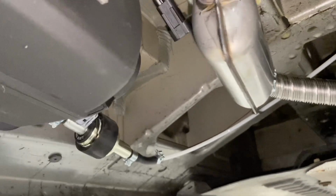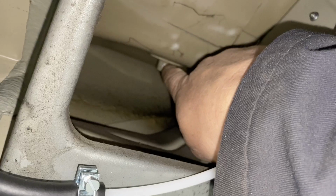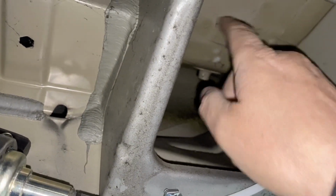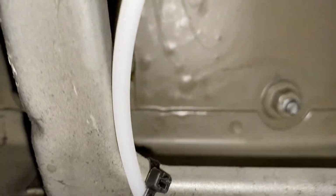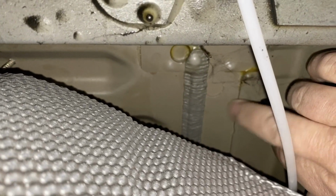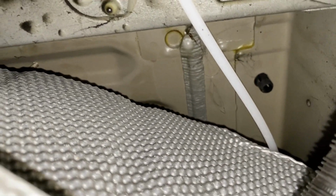Then on the outlet side, we've got lots of options where we can put this. Quite a very often used one is straight up inside here. That is the seat belt inertia reel mounting point inside the B pillar. So you can bring it out up here, which brings it just behind the seat inside the van. You can also bring it up over here, which brings it up just behind the driver's seat. The seat bolt is there, so this edge here is more or less the back of the seat, so you can actually go just about here, and that's just behind the seat base.